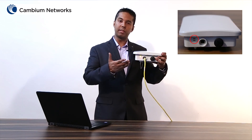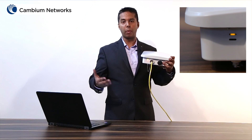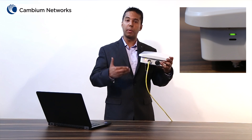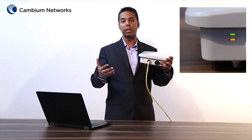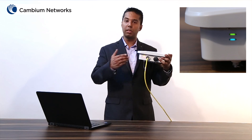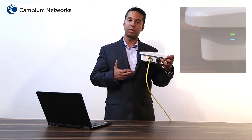On the bottom of this device there are two LEDs that provide the status of this access point. The first LED is a power LED that glows amber in color, signifying that the access point is powering up and initializing. When the access point boots up properly, the first LED turns green. The second LED glows amber in color signifying that the access point is working in standalone mode and is not connected with the CN Maestro cloud controller. The second LED starts glowing blue when the access point is working with the CN Maestro cloud controller.